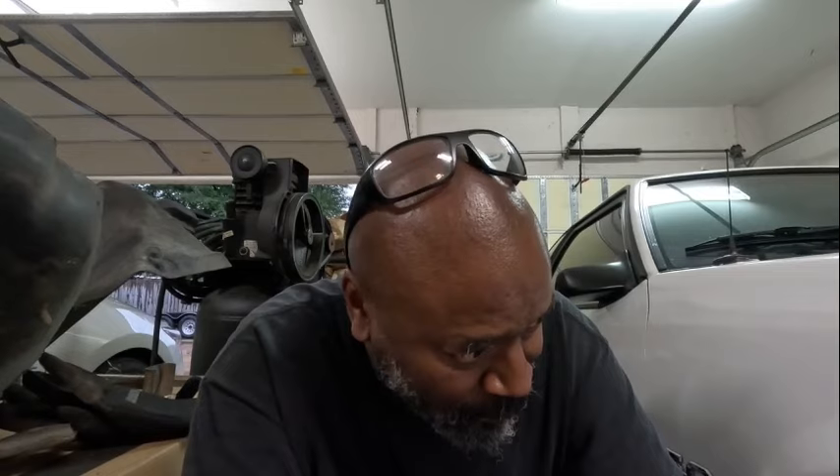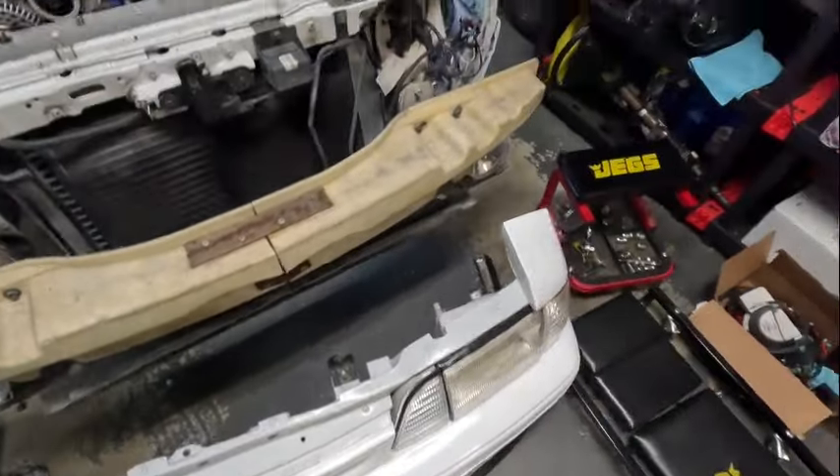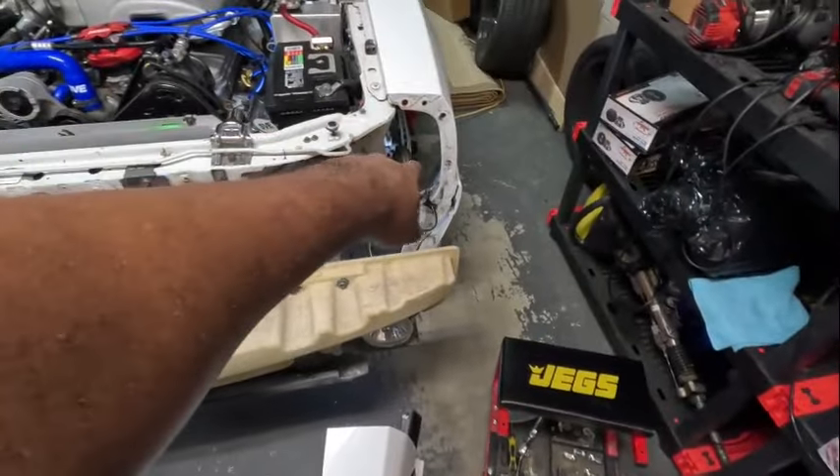Next I'm going to start pulling all the bolts out of the bumper cover. I found out I don't have to take the headlights out, so I'll leave those intact, just disconnect the harnesses from the headlights and pull it all out. Got the bumper off - not that hard if you've got the inner liners out and go from under the wheel well.